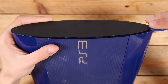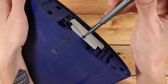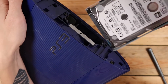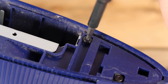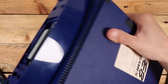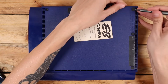Firstly, you'll need to remove this cover by sliding it towards the back of the console. Then we can remove the Phillips head screws holding down the hard drive, then remove the hard drive itself. There are three Torx security screws to remove using our Torx T9 bit. On the underside we can remove three rubber feet and the warranty sticker if your console hasn't been opened before, then remove four Phillips head screws.